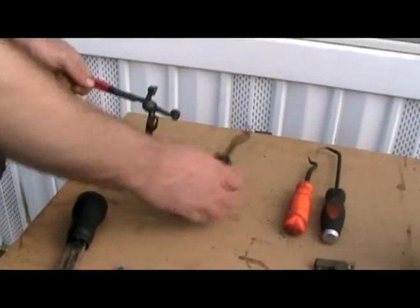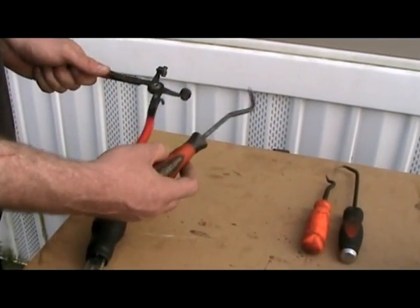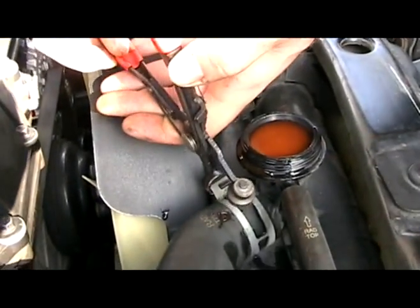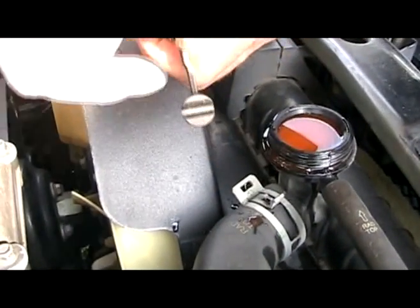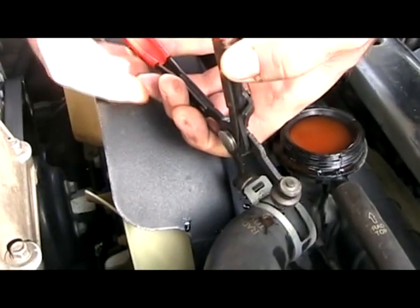Believe it or not, there's actually a ton of automotive uses for this thing. I know it's like 80 bucks or whatever, but it's helped troubleshoot some cars. I've seen these on the first tools video because they're essentials. These pliers are specifically made for these kind of radiator hose clamps. You just put the big long groove in that tab and put the bucket on this little stubby one.